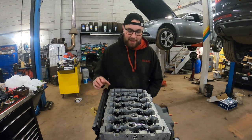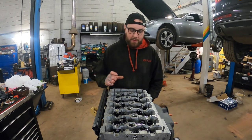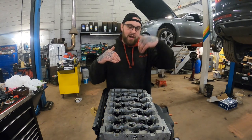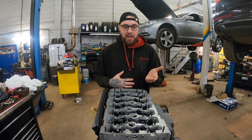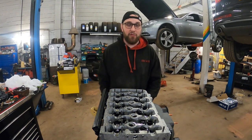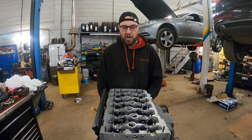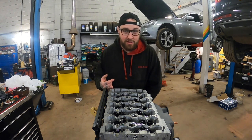I've got the double valve springs. I don't think they're really necessary for the power I'm going for, but I was worried about valve float. You can get valve float from revving higher, but also from boost pressure - when the boost is coming in and the valves open, it's pushing on the valve itself, working against the spring. The springs are made for naturally aspirated, so maybe it's not necessary, but I didn't want to risk it. I also looked at Supertech valves but a few people said they bend as well, so I stuck with OE spec.